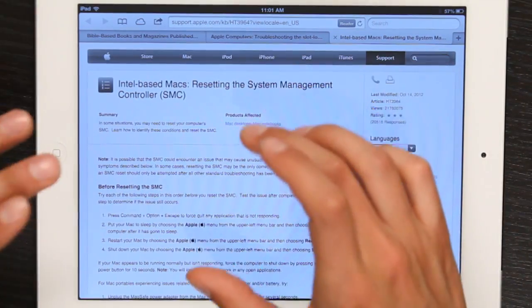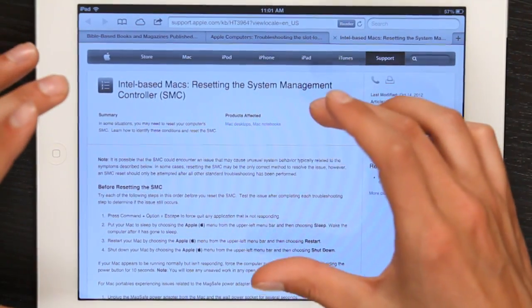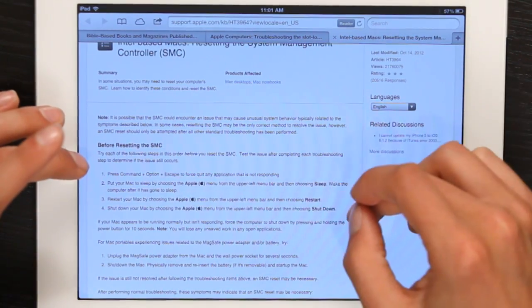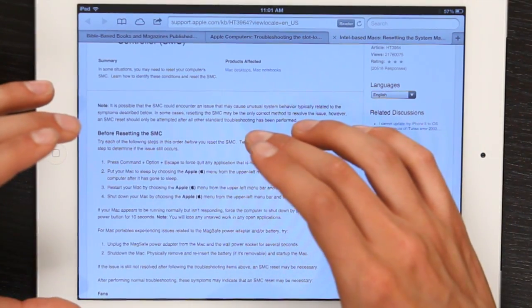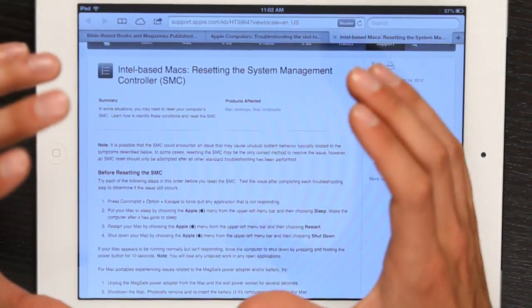That's probably the first and best thing to do. If you do successfully get the disk out of your drive, or say that wasn't the problem in the first place but you can't use it, you might try resetting the SMC. SMC controls power to lots of different devices within the computer. Here's another support article that tells you exactly how to reset the SMC. It's a little bit more complicated, but it's about four steps long. You can very simply reset the SMC. You may hear your fans spin up and get quite loud for a moment as it figures out the baseline for the computer, but this can rectify a lot of potential issues.